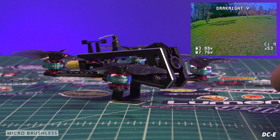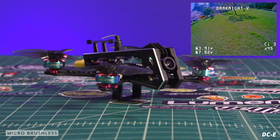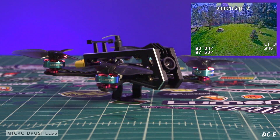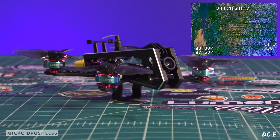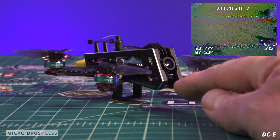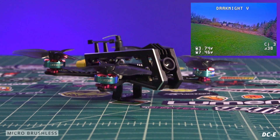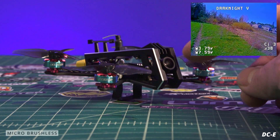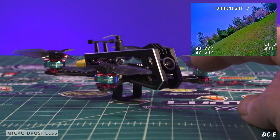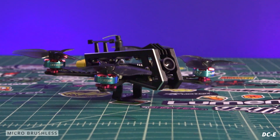This is the Lightning — one of my favorite quads from 2023, very fun on 2S. Around 2S 450mAh will get you about 8 minutes of flight time and it really does feel like a 5-inch. You can start with a pretty low tilt around 10 degrees at the bottom and go all the way up to about 25 degrees. For outdoor micro brushless, the typical range is anywhere from 15 to 35 degrees tilt. The higher you go with the camera, the faster your quad will go, and some people prefer more tilt to see further ahead when coming back around from a big power loop.